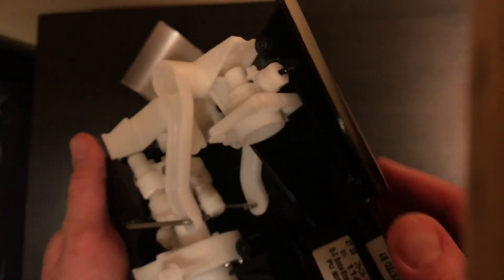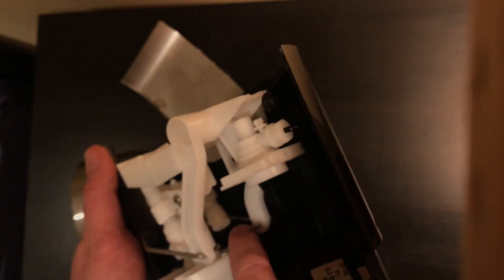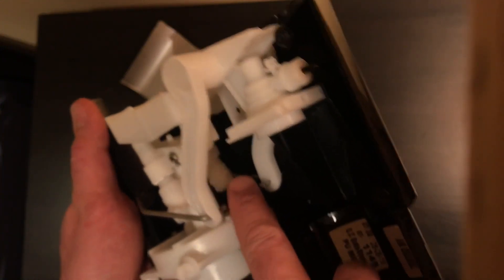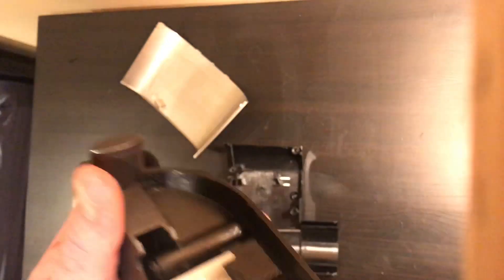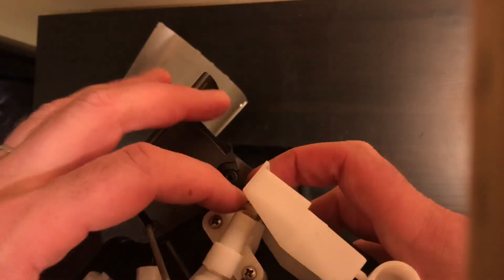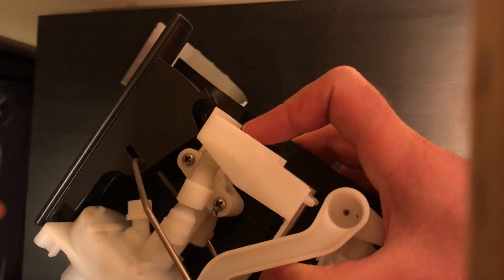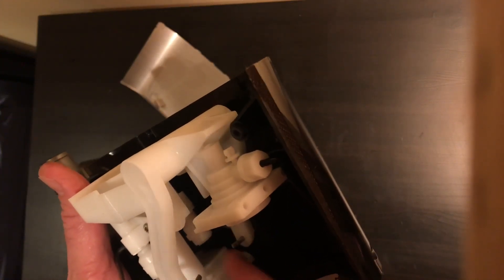The problem I had was this pressure relief valve here. Just over time there's a little spring inside — this piece that's just barely poking out screws in, and then there's a spring on the inside. There's one on the other side too, doing the same function. There are two copper-topped pieces that push down as well. For whatever reason, this just unscrewed itself and popped apart, so I had three pieces just rattling around.